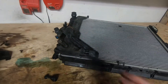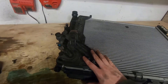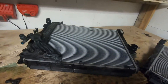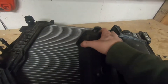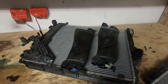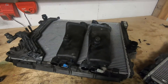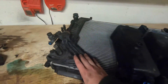I also looked up the expansion tanks because they do look slightly different online. Here are the expansion tanks — my manual one looks slightly different than my automatic. The automatic doesn't have this whole tab up here, but I looked it up online and they seemed to only have one part number for the expansion tank — it's the same for both. So you should be able to use the automatic expansion tank with the manual plate.